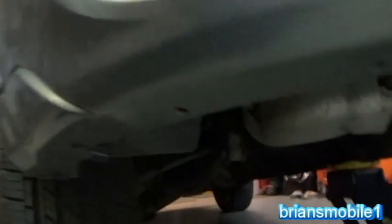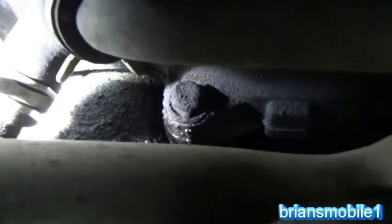This is a Subaru XT 2005, I think. It's a little bit newer than the one I just showed you on the WRX but you have the same leak. That's the oil cooler right there — it's just so covered in oil. The telltale thing is that you've got a leak on the oil filter.